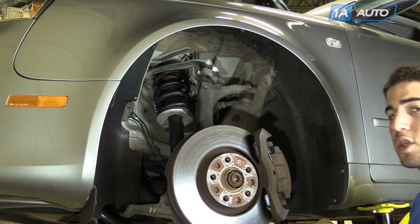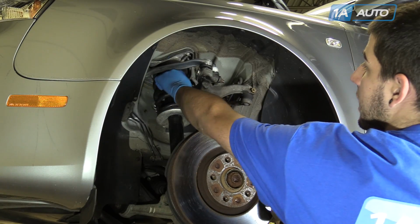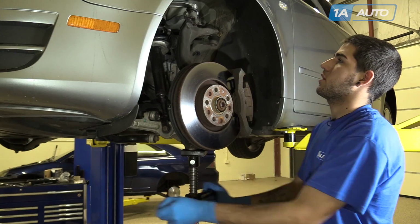Since the arms can't be torqued inside of the vehicle, you'll use a recreation of this measurement to set the angle of the control arm with the weight on before you torque on the bench. This arm will be aligned with our tape at both marks to 3.5 inches. We'll make our other arm parallel before torquing on the bench. Lower your screw jack or floor jack to release the weight from the suspension.